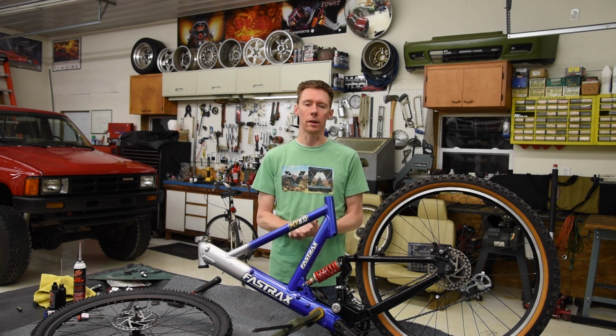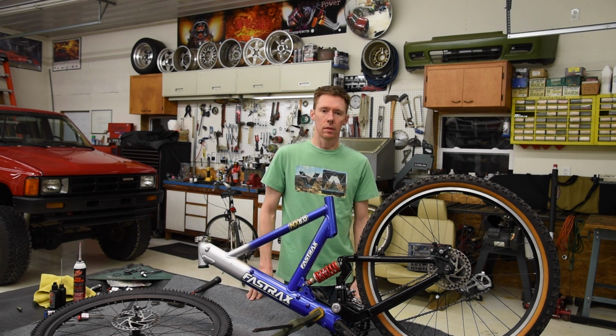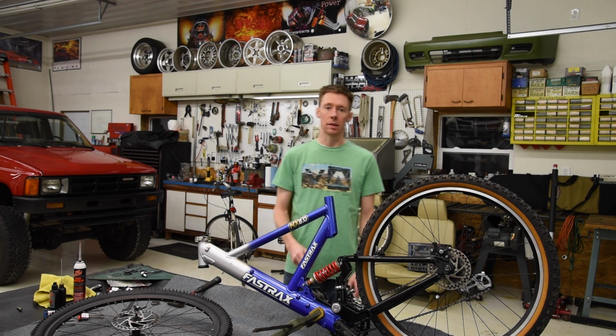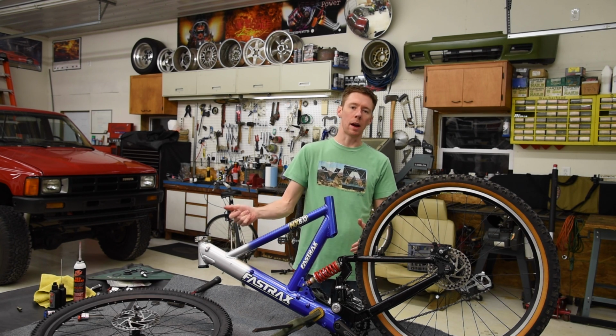What that requires is it must go into an oven for about 1 hour at about 1,050 degrees, somewhere in there. I've read different things online, but that's about what I read, and that's Fahrenheit. And that basically gets the aluminum to the point where it's going to almost melt. And then it must immediately be quenched into a water glycol mix. Now, that's in like a second. So it must go directly from this 1,050 degree Fahrenheit furnace straight into this solution. So basically gets dropped right in.